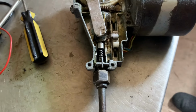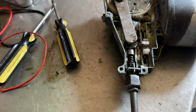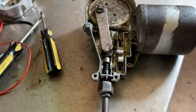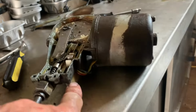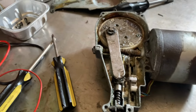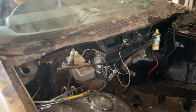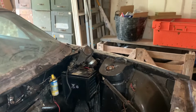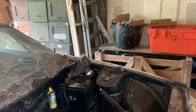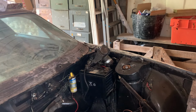If it works and I can switch it off by just getting the timing right, then I'm going to go with that, because this plastic unit under here, which is where the switch is held, is all sealed, and I don't plan to try taking that apart. We can't get it to switch off at all. It just keeps going and going and going. Anyway, it switches off as if you're between positions 0 and 1 on the switch, and then it will stop wherever it is.